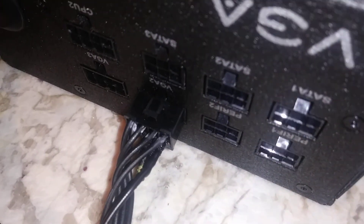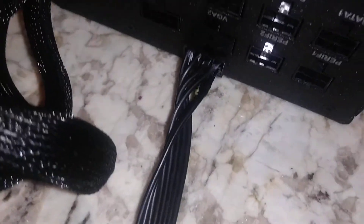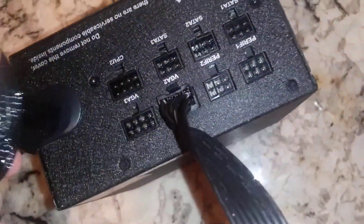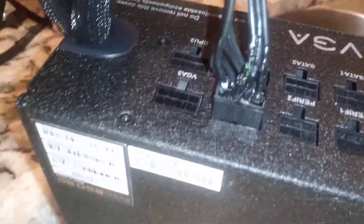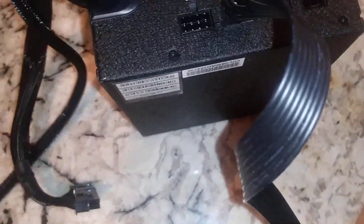This was a friend of mine's — he may have completely wrecked this power supply. This is not the cable that goes with this; it's probably a generic or off-brand cable that couldn't handle the amount of wattage coming out of it. Most of the connectors that come with this line have a BQ marking on them, and this one does not — so that tells me it's not the right cable.